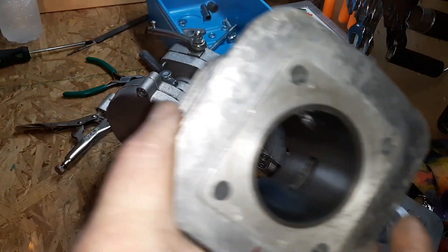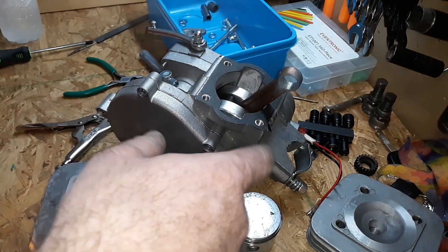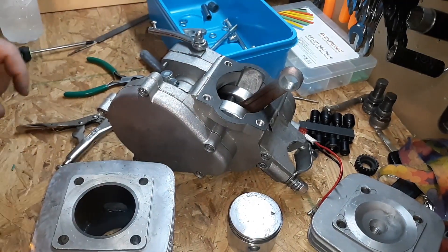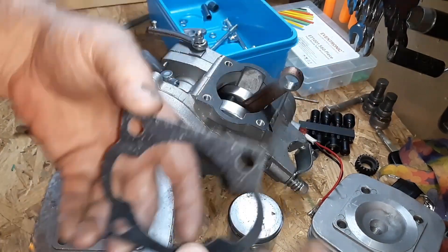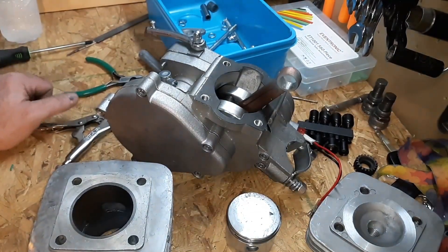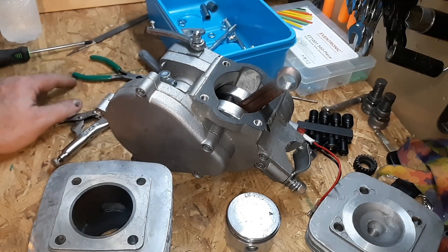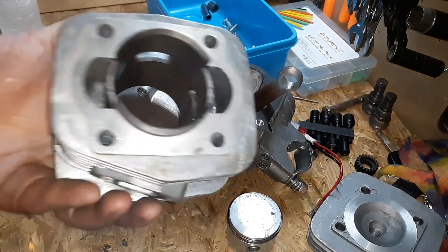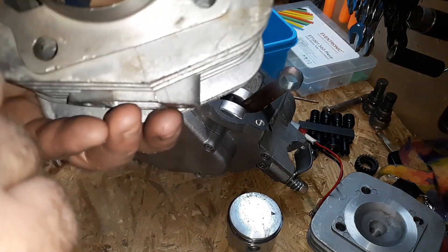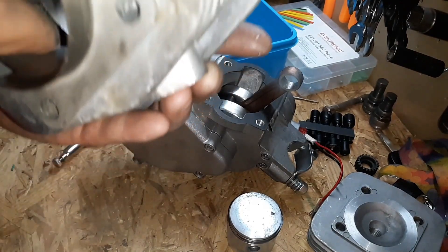There are a few funky things with this I can tell you right off. Number one, the fact that the bore is cut bad — there's too much play in that. I've got a 37 millimeter crank and they're double gasketing this. There's a lot of stuff. We've got to see how thick this is to the head — I'm going to map this all out, get a couple CAD drawings, see how it all goes, and figure out the timing that way. I have a feeling these are not going to be right the way that they are.